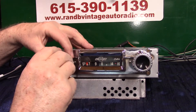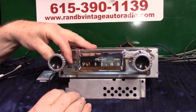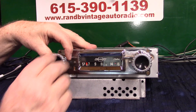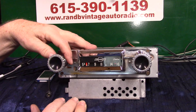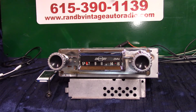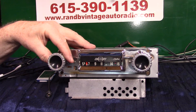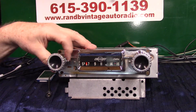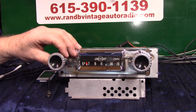Now we're going to show you how to work your balance and fader. You've got wide open bass, wide open treble. All you do is take it back about halfway, go clockwise twice — one, two — and let's go into fader. We've got four speakers hooked up here. Fader adjust. As long as you're moving it, it'll stay in that mode — there's your rears, there's your fronts. When you find what you like, stop, and she'll set it. Fader set. Now let's do balance — go counterclockwise, one, two. Balance adjust. There's the left side, right side. Balance it out where you like it, stop, let her set it. Balance set. Now you're back on treble and bass.